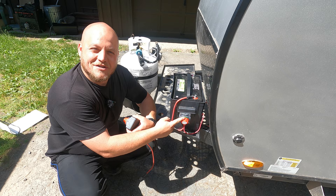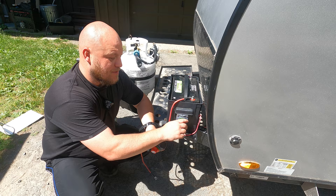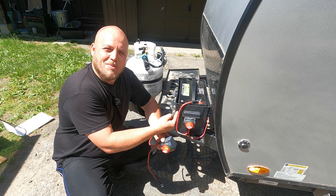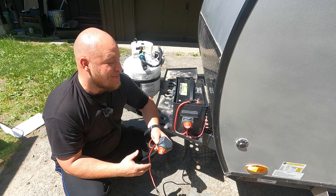To review this install: you have the wire from the camper going to the switch, and a short wire going from the switch to the positive terminal. This is all that's required to create a master switch on your camper. How you install it is up to you — just don't expose sharp pieces of metal inside your battery box when you're bouncing down the road.